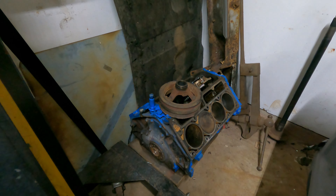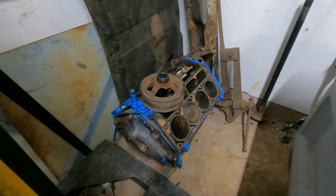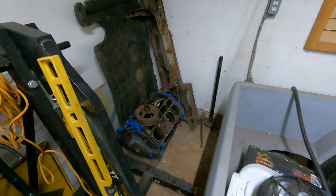There's the old motor right there. Just as a reminder: after a motor sits for a while, check the injectors. It's not very common that they hang wide open, but this time they did, and that was the result. I inserted a clip earlier to show you what they looked like — and that was the end of that motor.